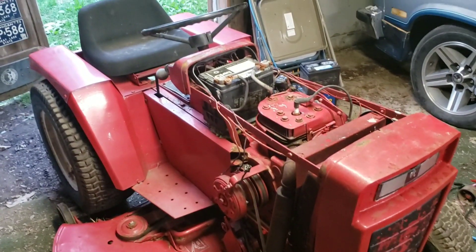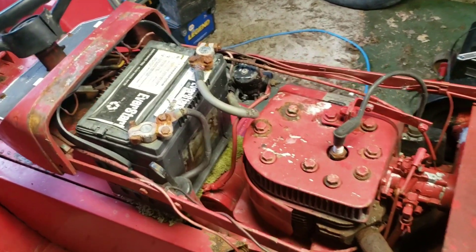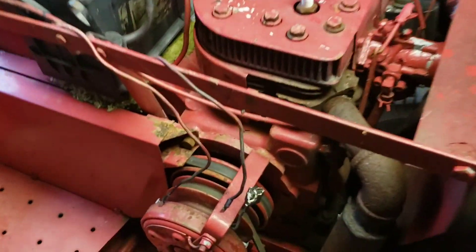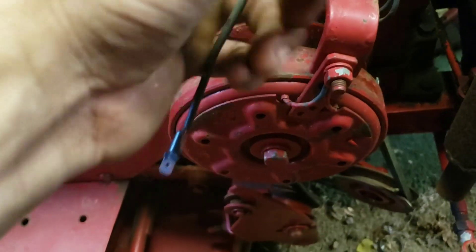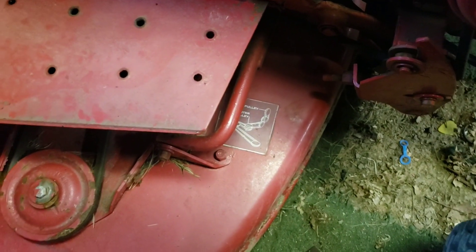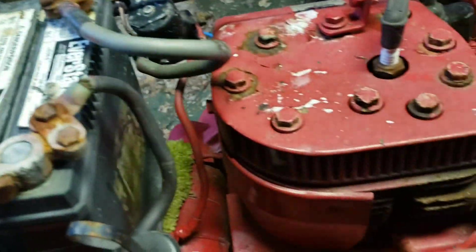We made it back home. I've got it in the garage here. I've got the hood pulled off. I'm going to put a jump box on it and see if it'll turn over, see if anything will work with the key, headlights, anything like that. I think this clutch went out because it's all unhooked and somebody stuck nails in it to make it tight up against the engine pulley, so pretty much the deck is just running constantly. I'll put a jumper on it and see if it'll turn over. If not, I'll pull these nails out and see what's going on.